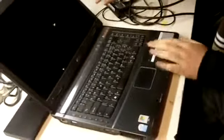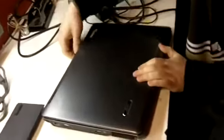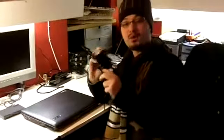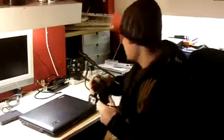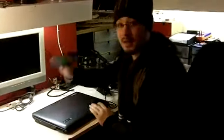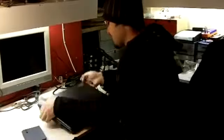So the next thing I do, if you have one, is to use another charger. I'm going to get a completely other charger, which is like this one but different, yet compatible with my laptop, to make sure whether the problem is from the charger or the laptop. As I said, we're going to get another charger, which I'm confident works. This works on any other models. And I'm going to hook it up to my laptop, again with no battery, and find out if it's working or not.